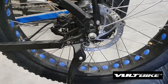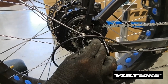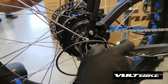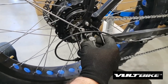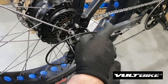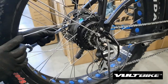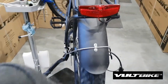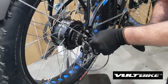You can hand tighten it and then I'll just grab my 18mm wrench and tighten that — that'll snug it into place. Tighten this up a few turns, that should hold. We're just going to tuck this washer up there, and then this axle nut we're going to tighten onto the axle — be careful not to strip it. The rest of the tightening we will do with the 18mm wrench just to make sure it is super secure. I tightened up the axle nuts, made sure everything was secure, and made sure that my rotor was balanced in the brake — it's running nice and smooth and it's nice and true.